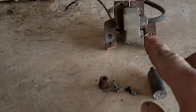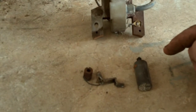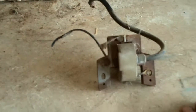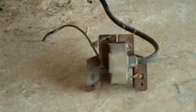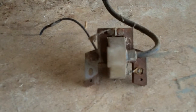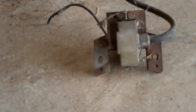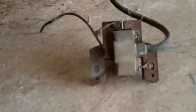Here's the condenser set and here's your coil. If you are working on an older engine like this that does have points and condensers, the replacement coil you can get does away with your points and condensers entirely. Don't buy the little clip-on adapter — this coil is 40-something years old, don't even try. Just buy a coil for a 135202 with any spec; it's electronic, put it on there and it'll fire every time. The only thing you want to do is be sure the flywheel key is good on the magnetron ignition — and of course on the points and condenser ignition as well.